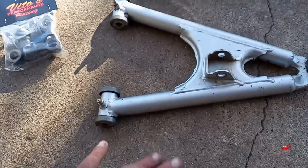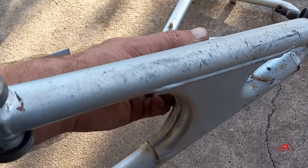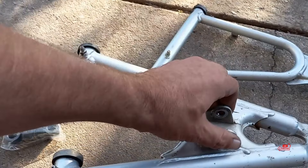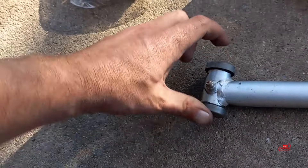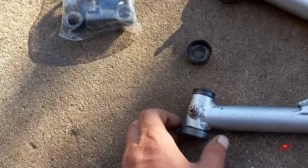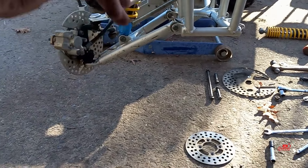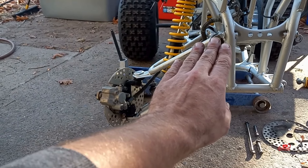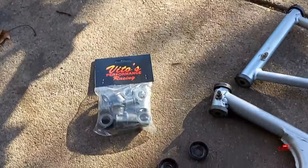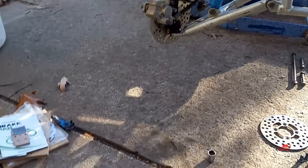The reason we took these off — one, I got the Yamaha silver touch-up paint. It's almost a shame to even do that but this bike is from '97 and the A-arms aren't even scratched up or dinged up. Definitely got lucky with the condition of the chassis on this bike. On Yamaha they have these things called dust caps on here — these simply just pull off. These will all go in the ultrasonic cleaner. Most of the bushings were okay — it's usually your upper ones that develop some play. One upper on this quad was a little bit loose, but you know, you're going to do it — you might as well do it all: steering stem, tie rod ends, everything, wheel bearings, brake calipers, all at one shot.